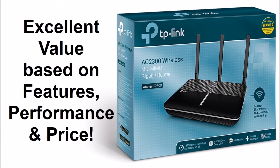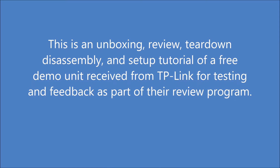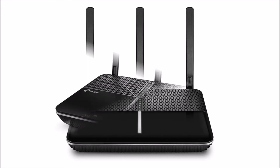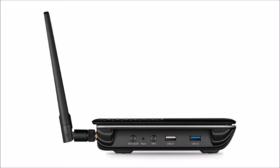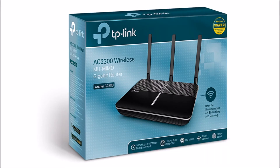Hello, my name is Ron Zee. These are my impressions of TP-Link's Archer C2300, a dual-band Wi-Fi AC2300 router capable of simultaneous 1625 megabits per second at 5 gigahertz plus 600 megabits per second at 2.4 gigahertz. This router offers all the features and performance an average household would typically need. If you like bargains, the C2300 is cost-effective and value-packed with high-end, modern, useful features.